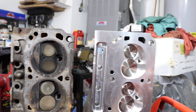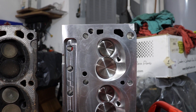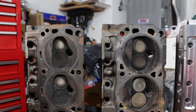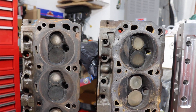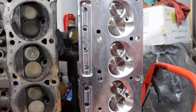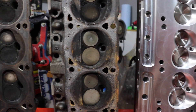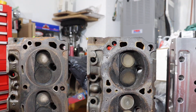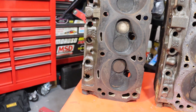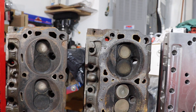This is going to be my toy and I wanted to be able to use pump gas with no issues whatsoever. So 10 to 1 compression ratio is going to allow me to do that. The key though is the shape of the combustion chamber and the size of the valves — it's a substantial improvement over the cast iron heads, both of them. You can also look at the deck surface and see the aluminum gives you just a nice, beautiful, large surface. The cast iron heads are rough cast production items and they're not meant for performance in any capacity.